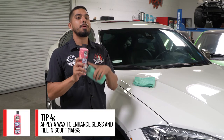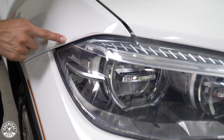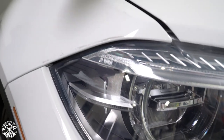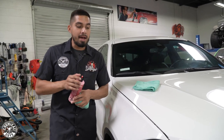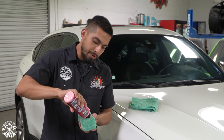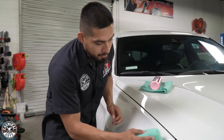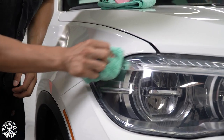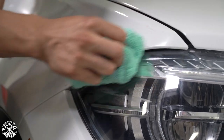Tip number four is going to be using Cherry Wet Wax on all types of scuffs. Come in close — there are these types of scuff marks around the bumper, maybe he got side-swiped, maybe he hit something, who knows. But you cannot return a lease with those scuff marks. Cherry Wet Wax is going to clean your paint, shine it, and protect it. Yes, you could polish them out, but in this occasion I'm going to use it by hand. Shake it up to mix in the product. Just roll it back and forth and you can start seeing Cherry Wet Wax removing the scuff mark. Let the product do its job — if you need more, apply more.